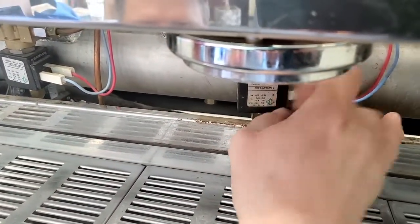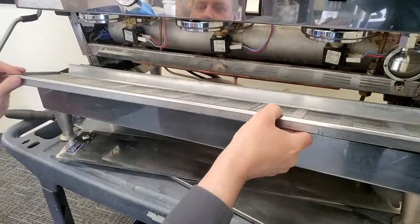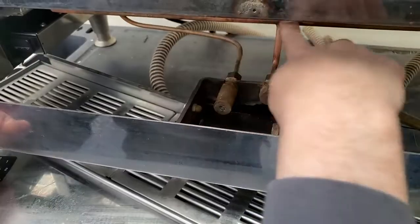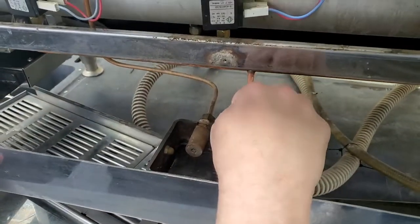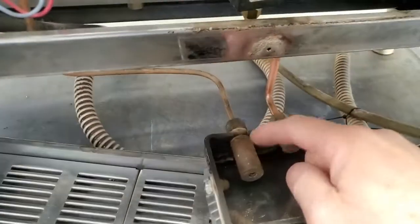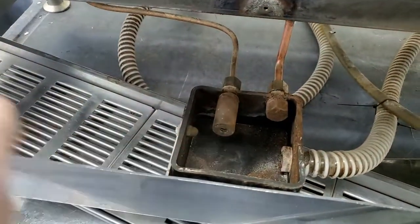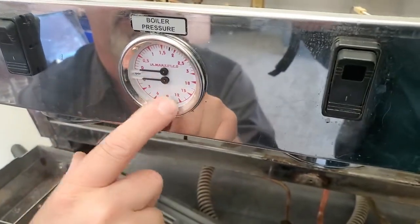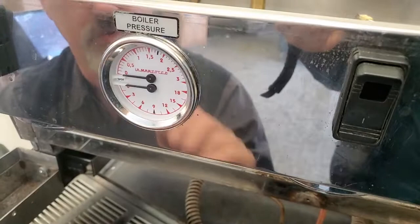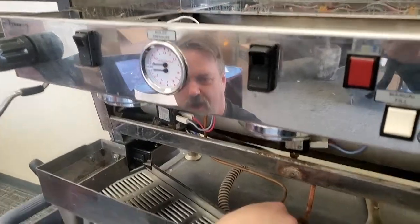When rebuilding a valve you have to take the whole drain system out, or you can disconnect the individual valve and re-disconnect all the pipes. The drain tray simply goes up and out. Our expansion valve is in this box and is adjustable. While the machine is heating up you set it by watching the pressure climb on the manometer — at about 12 to 13 bar is where you want to adjust it. Screwing it out reduces pressure, screwing it in increases pressure.